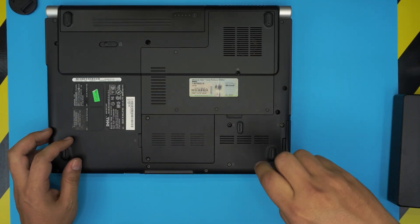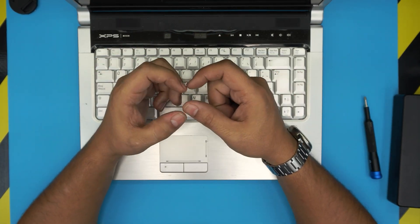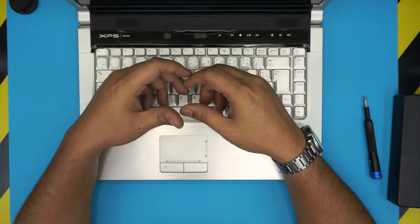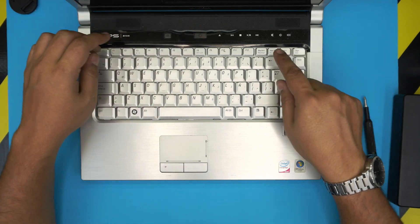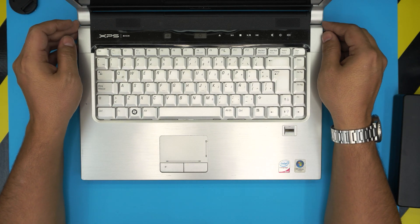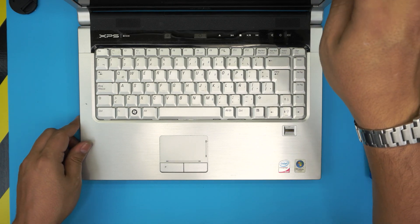Now that you have the hard drive installed, when you turn on the laptop you won't have any operating system on there. I made a video on how to create a USB boot drive for Windows and another video on how to install it on a Dell laptop — both links are in the description. Once you have your boot drive, place it in, power on, and start tapping F12 until you see the boot menu. Choose your USB drive and follow the steps to install Windows 10. With my tips you can have Windows installed within 10 to 15 minutes.